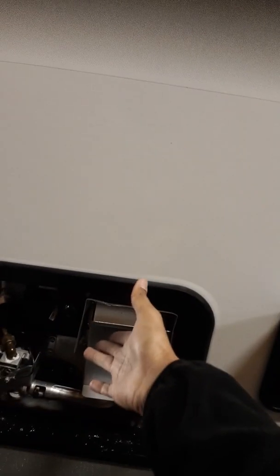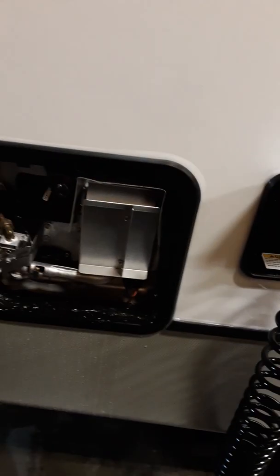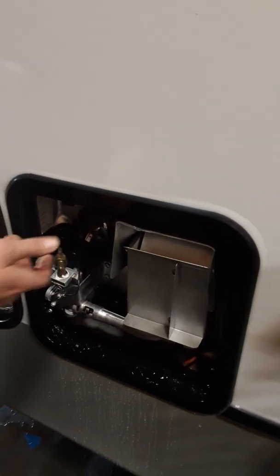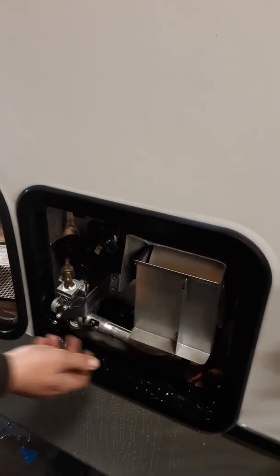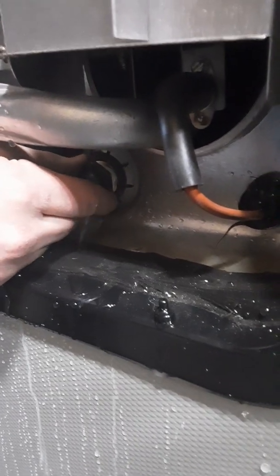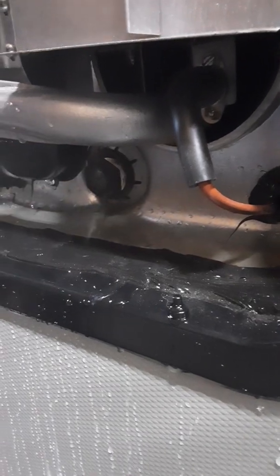Because if I'm at Colebrook, I don't need to check this all the time. If you got water hooked up to it, you got water running, it's always gonna be full. Unless you're off grid or you emptied it, because you empty it by just taking a socket right there, and this turns. Okay. So it's on tight right now. All you have to do is take a socket and a wrench, and you can turn that and dump the whole entire tank.